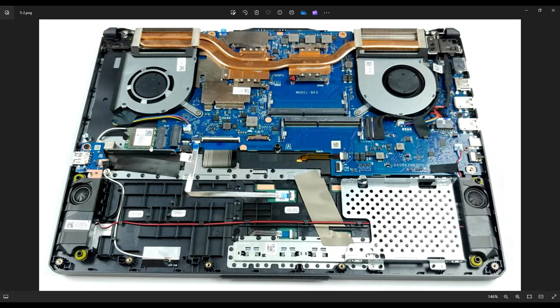Next I'll shout out the Wi-Fi card, which was a little hidden under the solid state drive. It's plugged into a similar-looking M.2 port and there's a single black screw here too. You undo that screw, your Wi-Fi card will release, and you can unplug it from the port. The black and white wires plugged into it are just snaps — they snap right off very easily. Those are your antenna wires that come down to your antenna on either side.